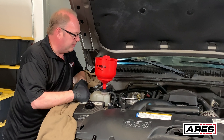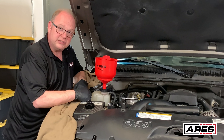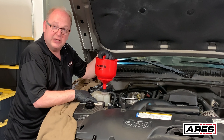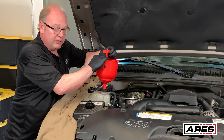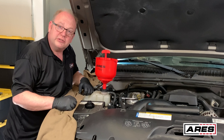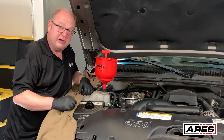When the air stops bubbling out and your coolant level stops dropping in here, you know you've got your system filled up, and then you can go about your way. It's just that simple and easy. One thing I want to mention: when you pull this up, pull it up until it clicks — that holds it in place for you. So there you go. Be sure to register your tool, join our VIP club, and stay safe out there. We'll see you next time.